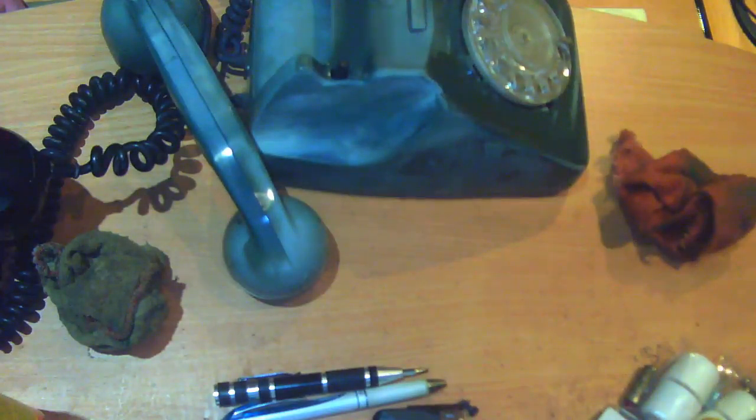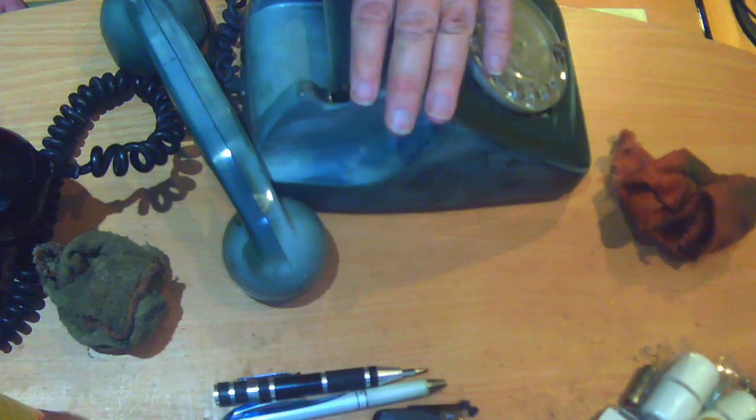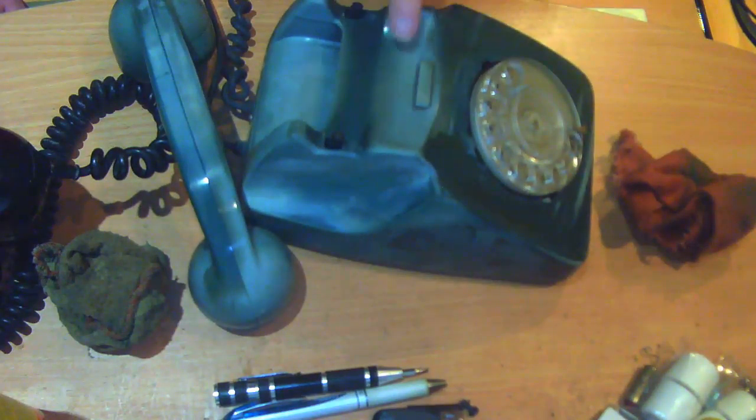But yeah, if you watch my video, an alternative to the retro bright process, I do restore a grey phone on that has gone brown, and that is done with acetone, and that certainly takes it off. But this white on this is something different. This is something else, and I think somebody's had a go at retro brighting this, using the, what is it, peroxide or something that they use, and I think somebody's had a go at this case with that, because I know for a fact that when people do retro brighting, they say if you do it on a dark colour, you do get a white bloom on it that you can't shift.